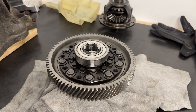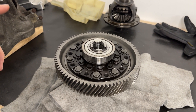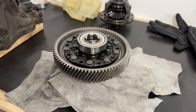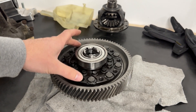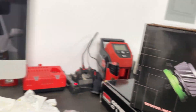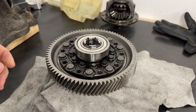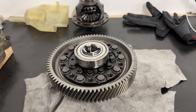There is a long write-up on this thing online that explains how it works, and almost every person selling it just copies and pastes WaveTrack's write-up in their product description. The basics are that this is essentially a helical differential, but their claim to fame is that if a tire slips and starts to spin, it will lock power to the tire that is not spinning. So this thing will transfer power in a wheel-lift condition — the whole reason we're all here.